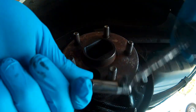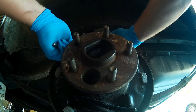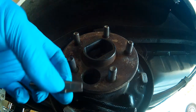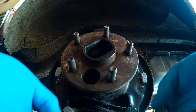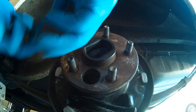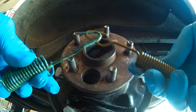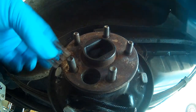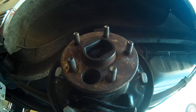Alright, next up the pins. These are the pins that push out our brake shoes on the back side here, and they clip into the rubber seal in the wheel cylinder. Also giving just a little bit of anti-seize inside the groove where the brake shoe is going to index into. So here we've got all of our springs for this side — these are our shoe retainers and our front and rear springs, and our bottom return spring. Don't lose your return spring for your spreader bar if it's not provided in your kit.